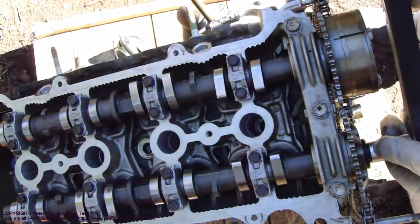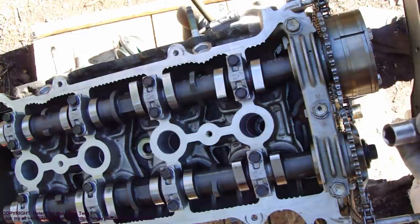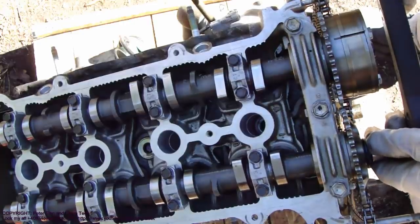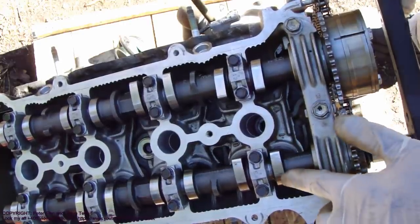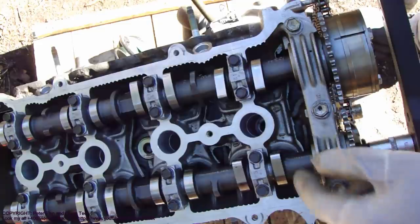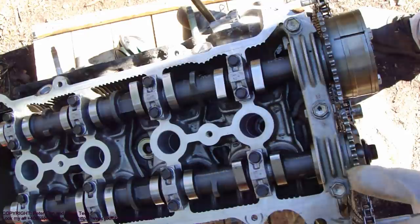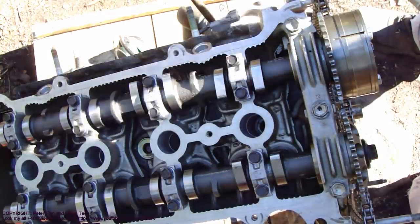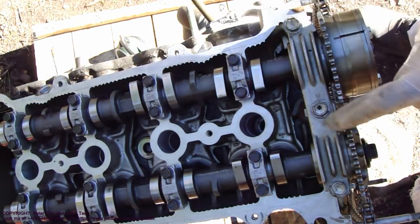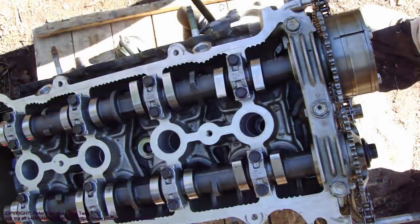Okay, and then if we need to set up this camshaft, we insert that 14 millimeter socket in here, and then we can move that camshaft in this way and in here, and then we only rotate these camshafts so that those cams point up, like in here. Okay, this was the second check. Okay, and then when we have checked these and these pistons, we go to the next check. And I take a different view.